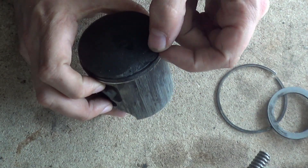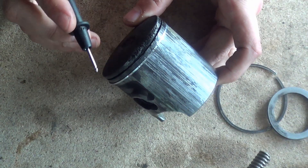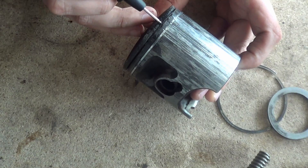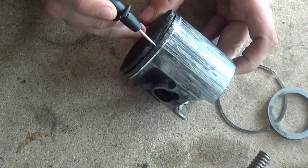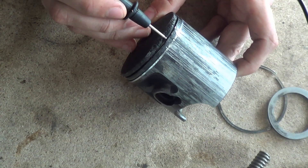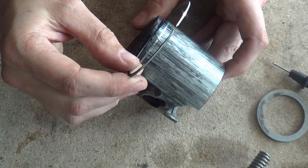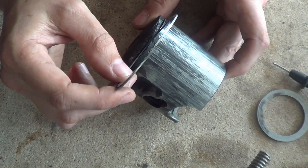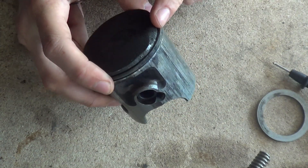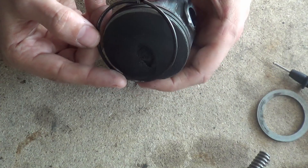This is one of the thinnest sections of the piston here, so it just starts to blow off the sides, corroding away, and you get pre-ignition here because of all those sharp edges. You can see that this top ledge has disappeared while the bottom ledge is fine — that's because there's a piston ring in the way. Because it's chromoly, it just sits there, shields it, absorbs and transfers heat to the cylinder wall like it should. But that is nasty — a great example of pre-ignition.